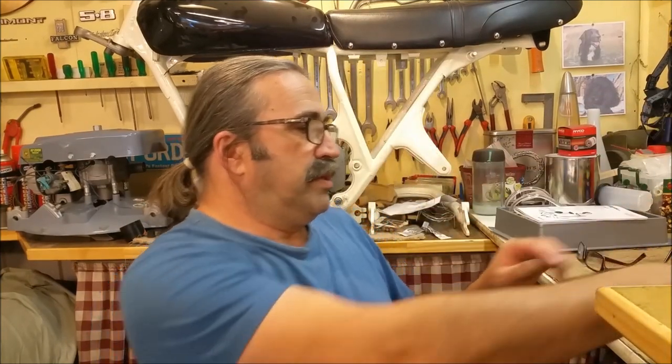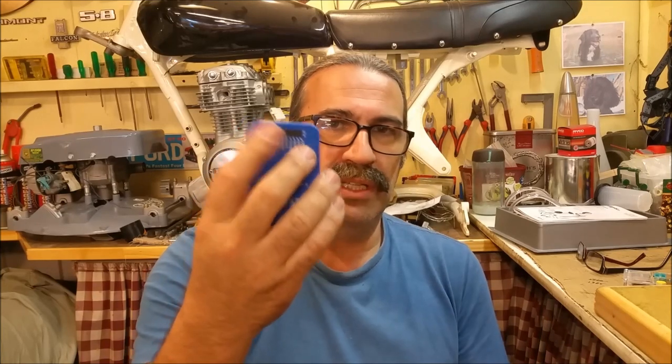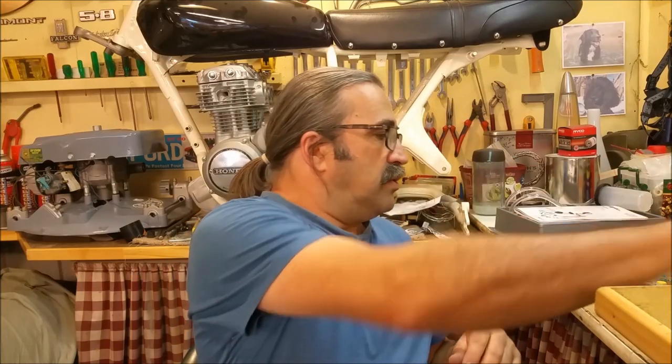Now, there's other little bits and pieces, LED testers, you know, if you're doing a circuit and you want to use an LED in it or whatever, and I have used them in cars as well, you can test the integrity with those to make sure it's working the way it should, particularly if it doesn't come on when you think it's going to. It might be blown. You can't tell when LEDs are blown. They don't blow up. They just don't work. So they're good for that sort of thing.